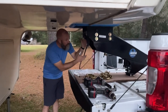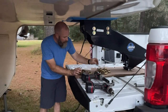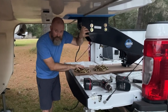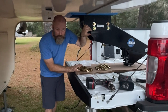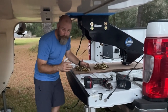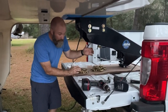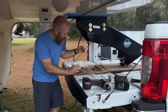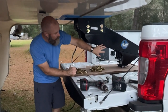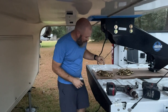I'm going to raise the trailer up so I can stand under here without hitting my head. I went ahead and got our safety chains ready to install. When you order your goose box, the safety chains don't come with it standard — you have to order those separately. I ordered mine from e-trailer; I'd recommend them highly, great customer service. Make sure you order safety chains rated for the weight of your trailer — more importantly for the weight of your goose box setup.